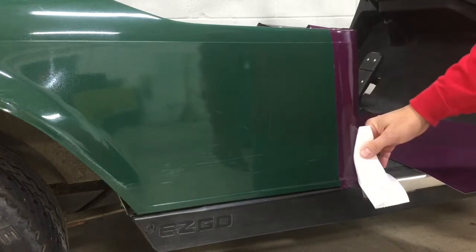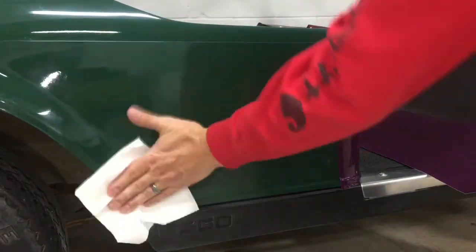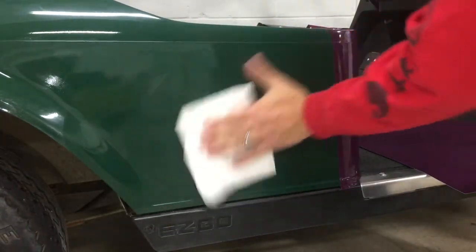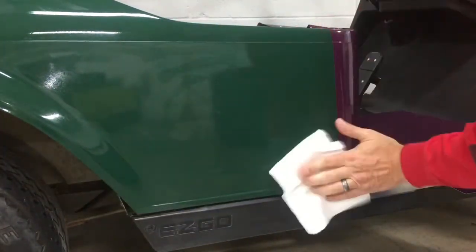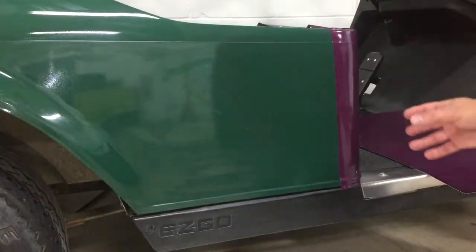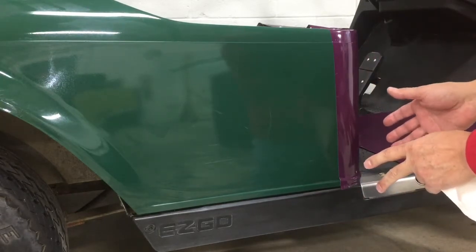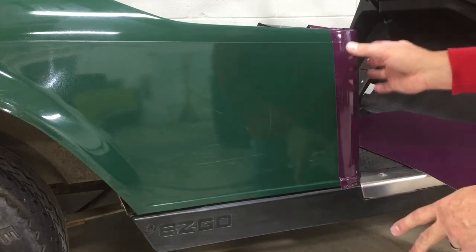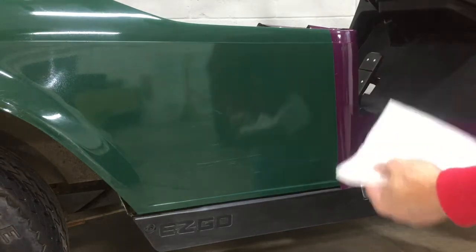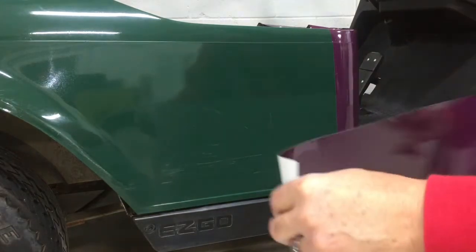You're going to wipe right over top of the sheet that you already have installed and re-prep very thoroughly. This should have already been done multiple times before you get to this point. Re-prep that panel — all the handling you did on installing it creates a measure of contamination from the oils from your fingers. You want to make sure that's all off so that you get a good bite when you do your overlap. Now we've prepped with our rubbing alcohol and paper towel, and the next panel — your side panel — is going to be installed.